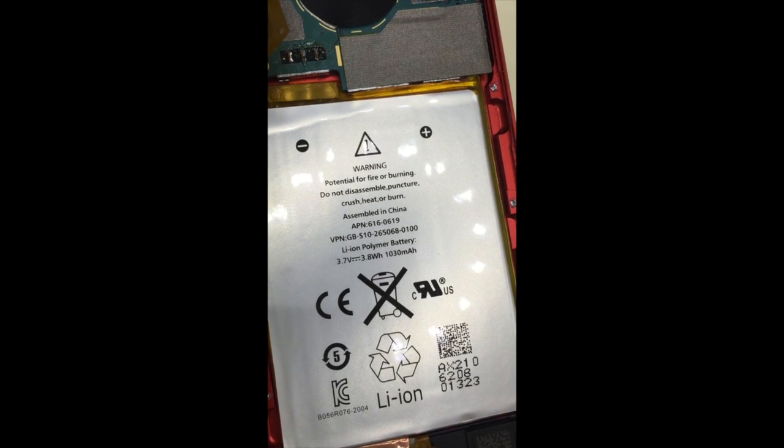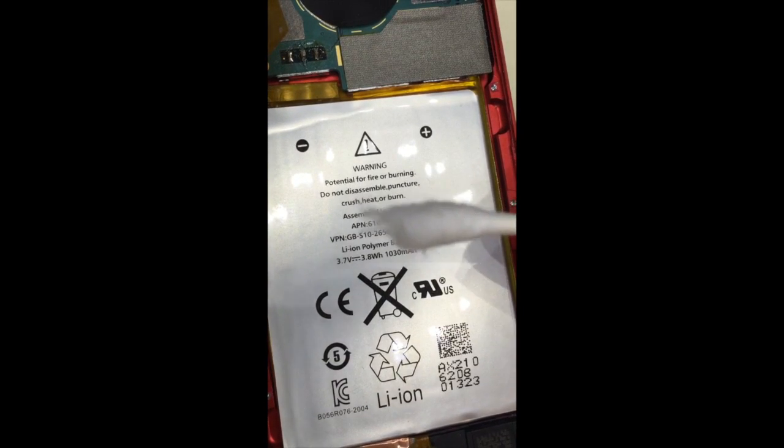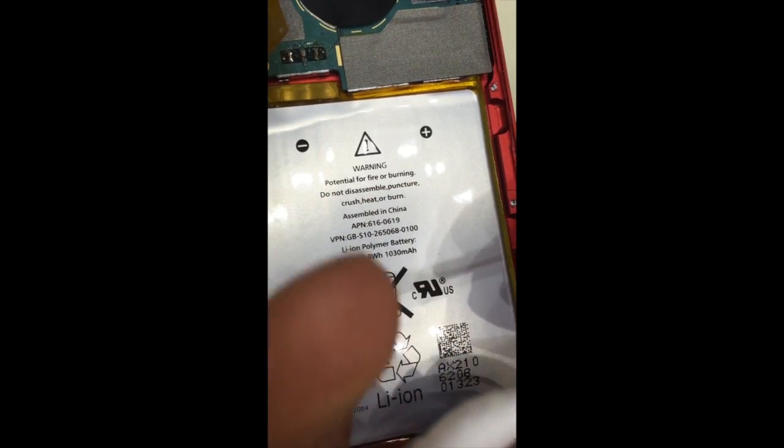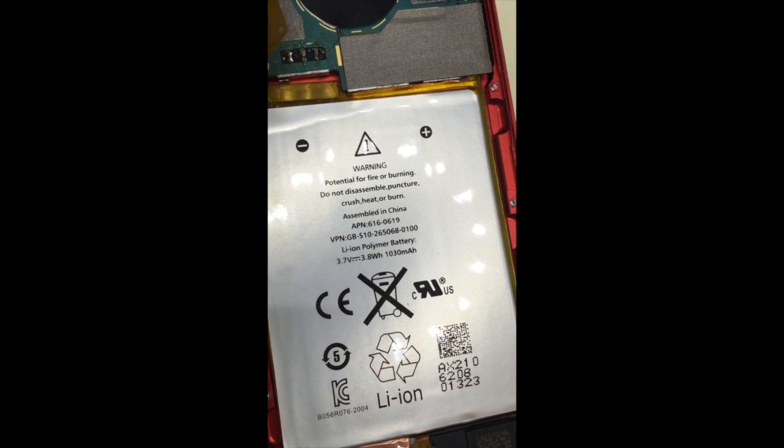If you have some rubbing alcohol, you might put some on a Q-tip and brush away any flux from that area. And of course the alcohol will evaporate very quickly. That's what I'm going to do now, just to make sure it's a clean area, you don't have any short circuits. Okay, here's my Q-tip. What I'm going to do first of all is remove some of this cotton, because you're going to get pieces of cotton stuck in part of your circuit.